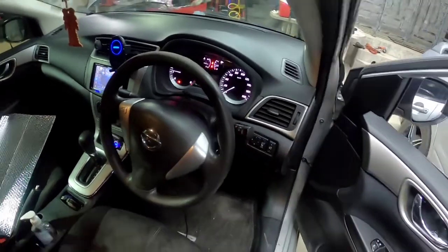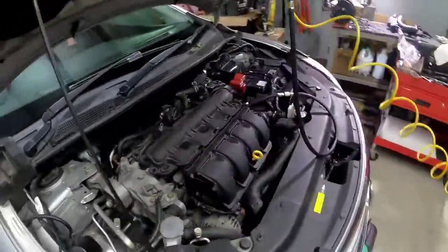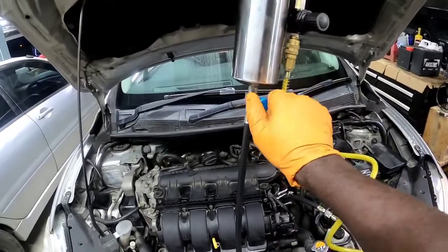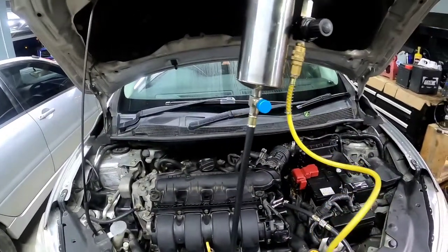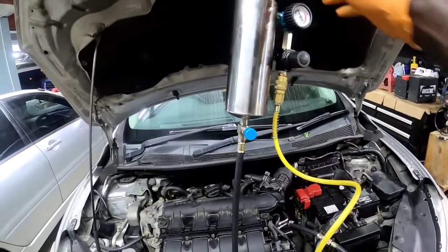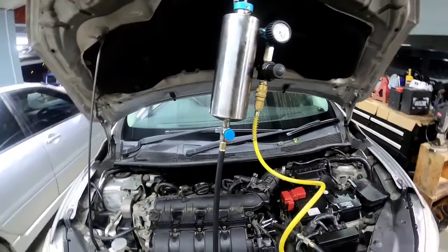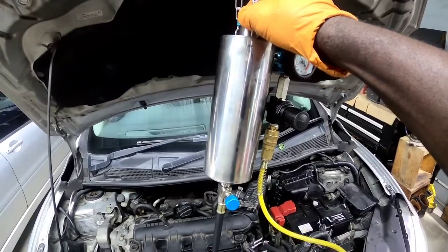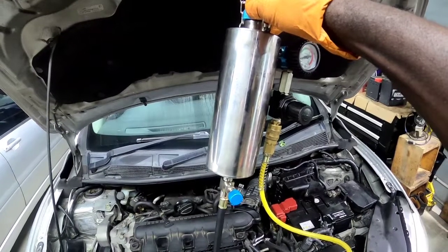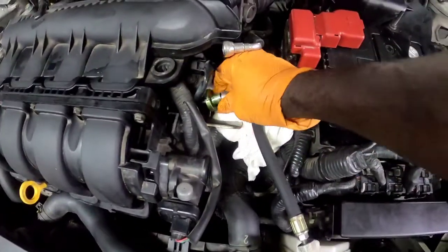This procedure is to make sure that the injectors stay as clean as possible. I also cleaned the mass airflow sensor and the throttle body to help decarbonize the engine. When you finish, lock off the valve, you'll hear the car stop, then disconnect everything. On top, the cap has a release valve — make sure you press that to release the pressure trapped within the system.